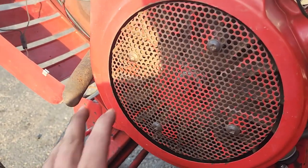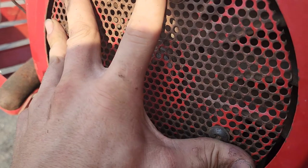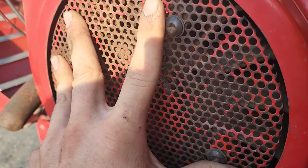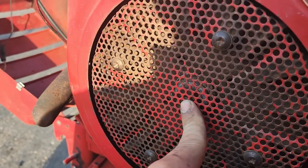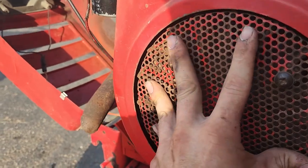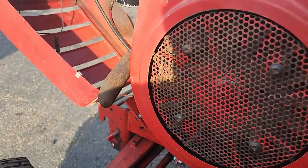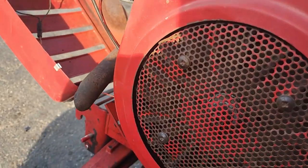I got to looking and playing around, and — look at that — that's me moving the flywheel. The nut here is all loose. This whole flywheel is falling off because it's throwing sparks on the starter gear, and I'm moving the whole thing — it's not even tight.